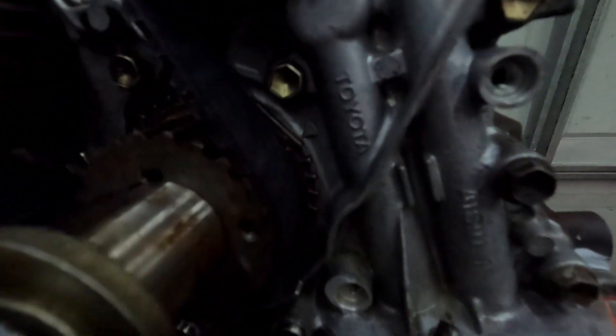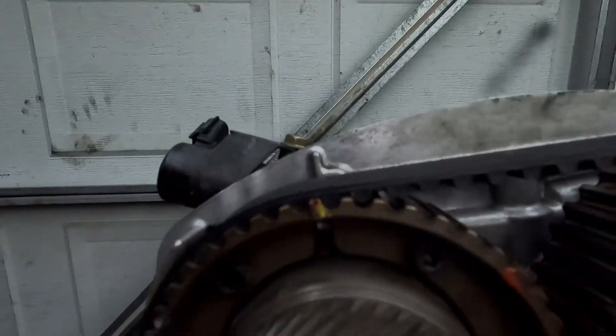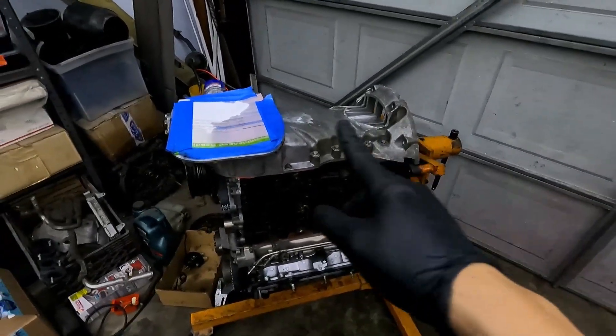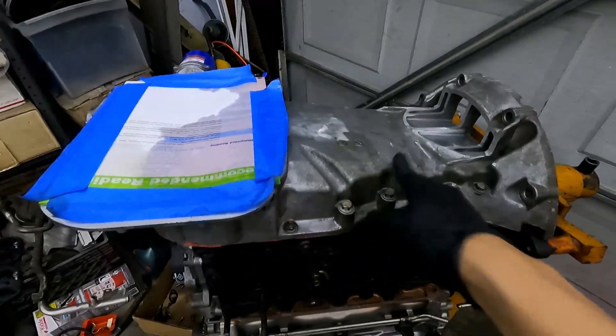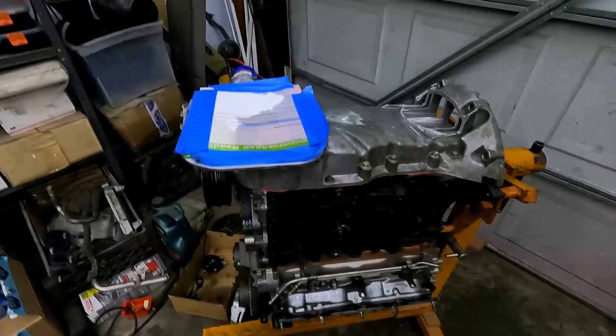To me that's lined up now — that's more or less lined. And lined. Long story short, I forgot to add in the baffle, so I had to flip it over and put in the baffle. Check out that oil pan though. The problem I have right now is I'm trying to drive on Tuesday, but I have this smashed oil pan with this smashed pickup with the screen busted.